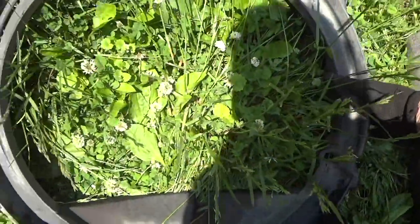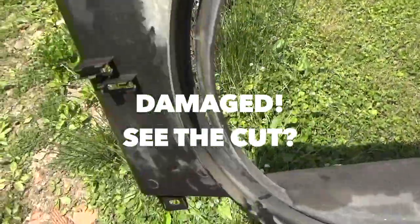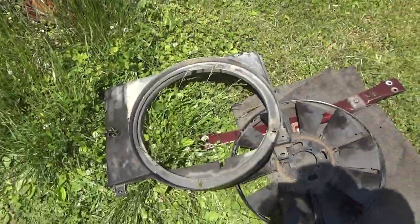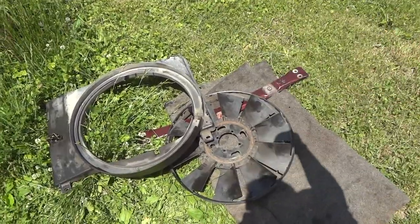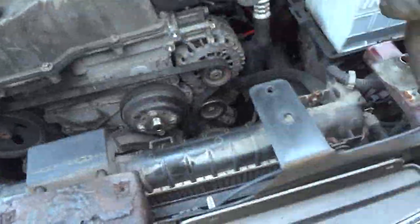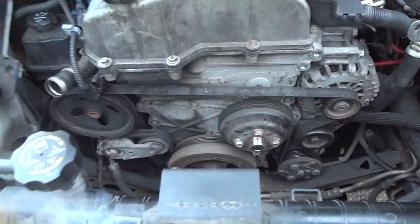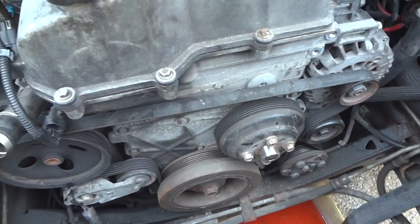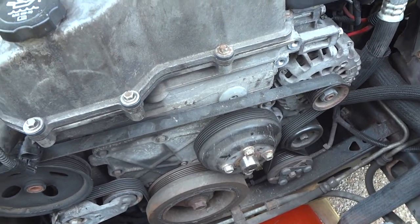Just unbolt this from the back of the clutch fan and separate it. You'd think they would have made this a two-piece deal like most manufacturers, where you take the top off and slide everything out — but no. Anyway it's out. Just disassemble your fan and bring it out — you probably won't even need to do much there. That was about 10 minutes of work I kind of wasted.